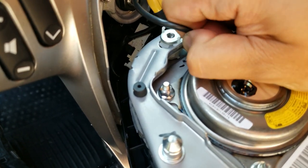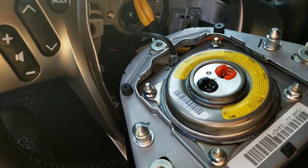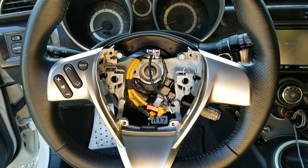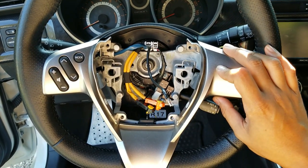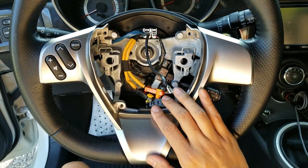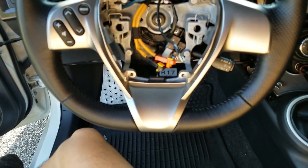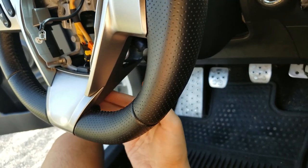It's on there pretty tight. I'm going to go ahead, remove this, take the airbag off, and then show you how to get the plastic trim off next. I've partially removed some of the trim already but put it back on so I can show you what to do. You will need to remove the steering wheel because there is a screw on the backside of this piece on the bottom part, and the plastic trim here is blocking you from getting to it.